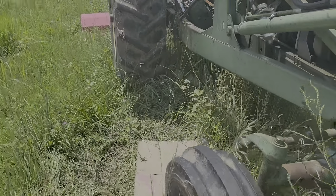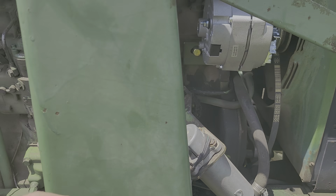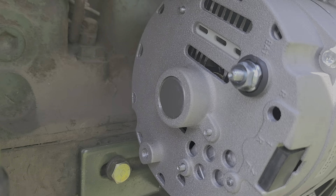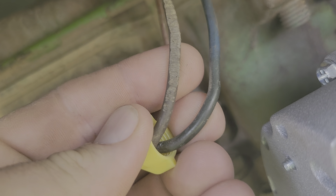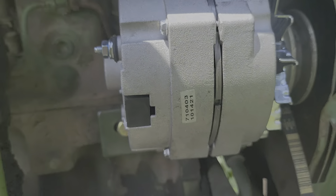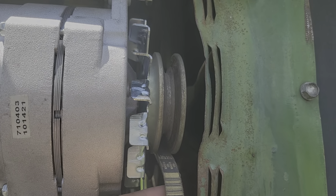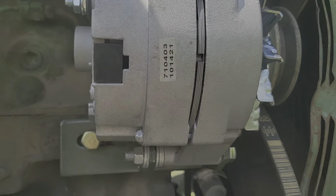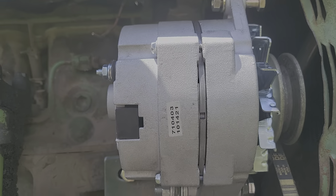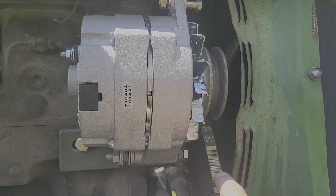There's another issue: the block heater is going to have to be redone. For the alternator, I've got two wires — the blue and the brown — I've got capped off right now, and they're eventually going to connect to this guy right here. But I can't get the belt to go over it — it just seems to be too short. Maybe I just need to order another one. I've got my bracket on as best I could, but the bottom line is the belt seems to be too small.